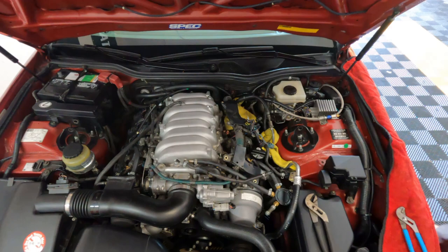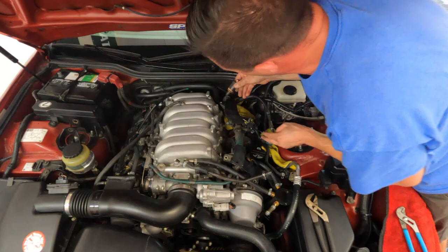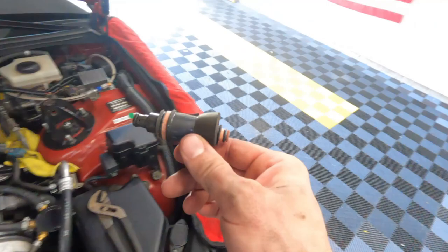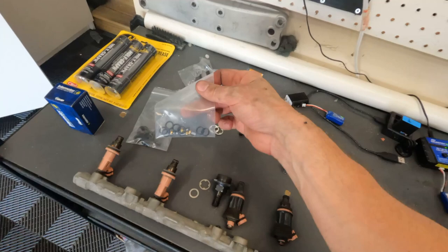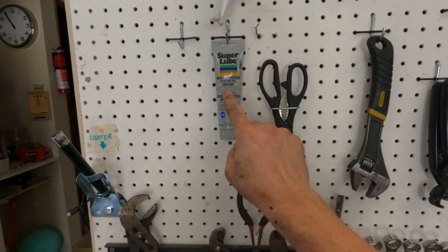Once you have the damper off you should be able to get this rail out. Here's the rail. Make sure your injectors all come out along with o-rings and things, and try to avoid dropping debris down in there. Pull these out carefully — if you just give them a little twist they should come right out. So that's what it looks like with the rail gone, and here's one of the injectors. Now I'm going to show you how to replace the o-rings and the micro filter baskets using this kit here.